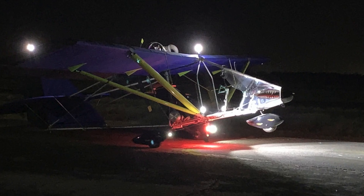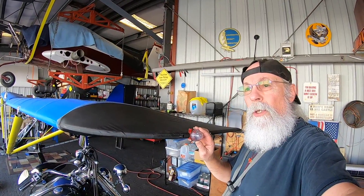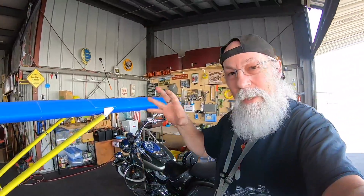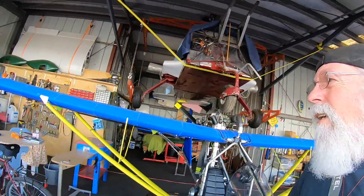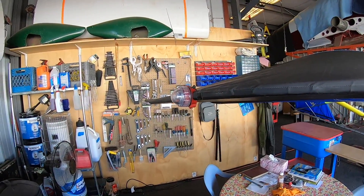I don't know if I can do it, but I'm going to try to get a still shot, and we're going to change right now. A couple hours later — hey guys, out at the hangar. I came out to do an increase of voltage. My strobes were very, very — not dim, but they weren't putting out as much lumens as they should. See if I can flip one on. And so I turned up the regulator a little bit so it flashes a little bit brighter.